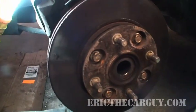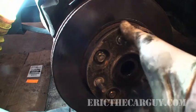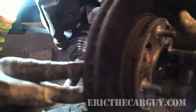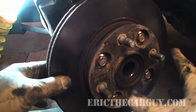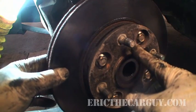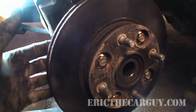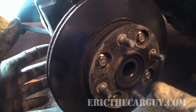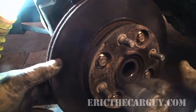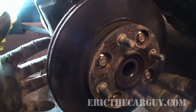Some people have suggested, based on my other video, that you could just remove the axle nut, put a slide hammer or equivalent assembly on here, and just slide hammer this whole hub assembly right out of the bearing. I don't like that, and I'll tell you why. What you're doing at that point is separating the bearing — the inner race will stay with the hub and you leave the inner part of the bearing exposed. If it doesn't come apart cleanly, you put it back together and it's hit or miss whether or not that bearing is going to go bad.